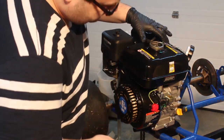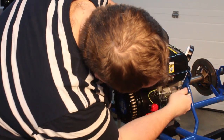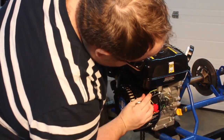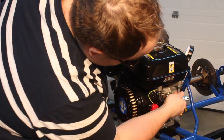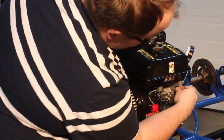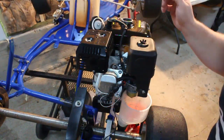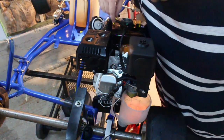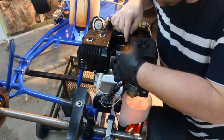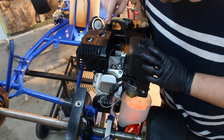To start the removal of the fuel tank, we have just two 10mm bolts up here and they are upside down, so remember that you have to back them off in a backwards fashion. This is a 10mm wrench. Then on the back of the engine you're going to see the breather hose for the fuel tank vapors — we can just kind of take that out of the clip.